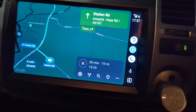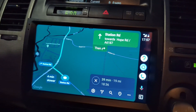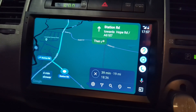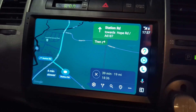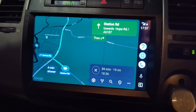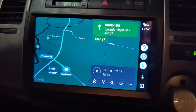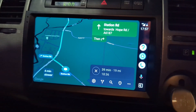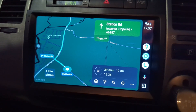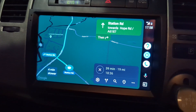All in all, this has been such a good purchase for me — being able to have wireless Android Auto. I don't have to plug it in; I can just leave my phone in my pocket and it will connect. It was fairly straightforward to install. I did need a 68-ohm resistor to get the steering wheel controls working, and also the air conditioning and climate control didn't work without it — it is quite essential. But for less than £200 total spend, it's been absolutely brilliant, and the reliability has been excellent.